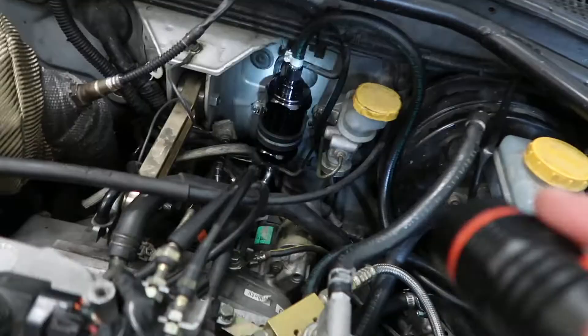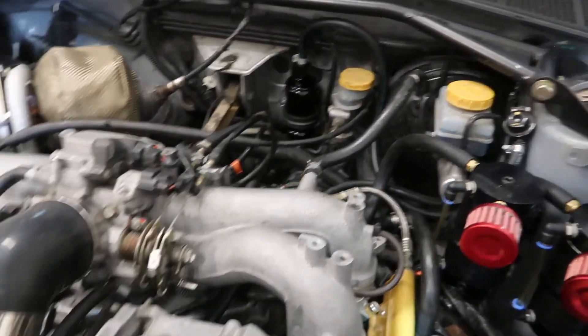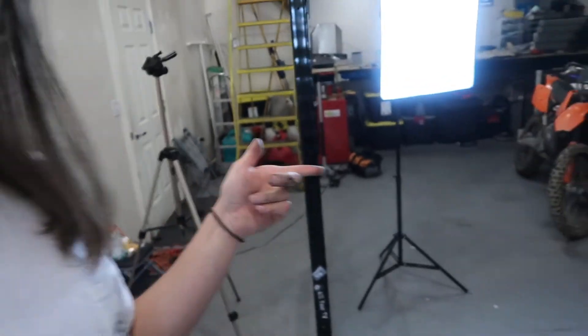Double check the other side. We've got to check all these little hard-to-reach areas - feel if they're wet. Check all of our fuel filter fittings, check both fuel rails. Got it pressurized again - I don't hear it leaking this time. One more spot we can't forget to check is where we installed the fuel pump, there are fuel lines coming out of there that we had to take off. So far though it looks really good everywhere else in the engine bay, so I'm stoked on that. No major fuel leak issues - everything got fixed.